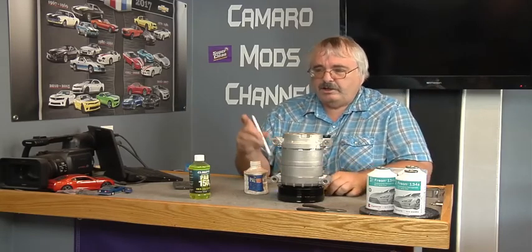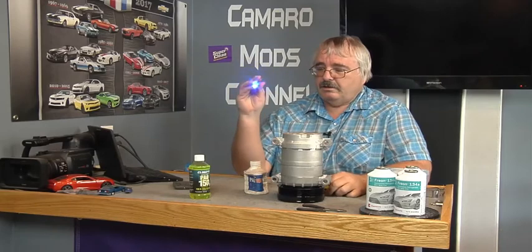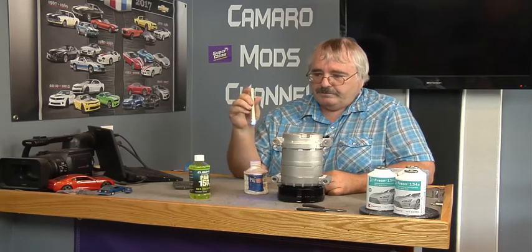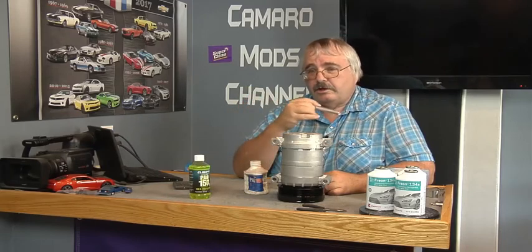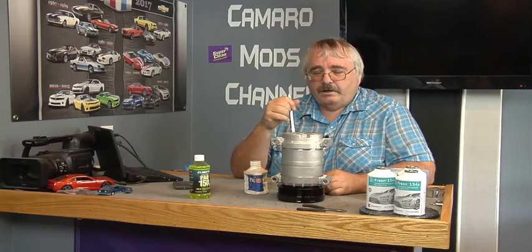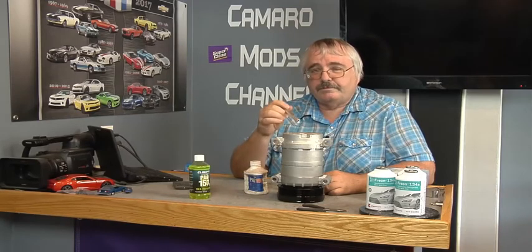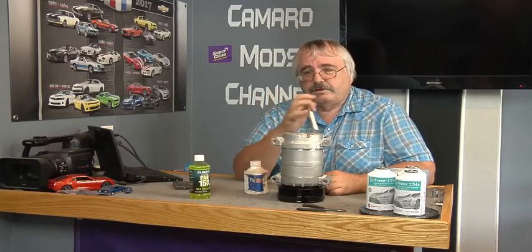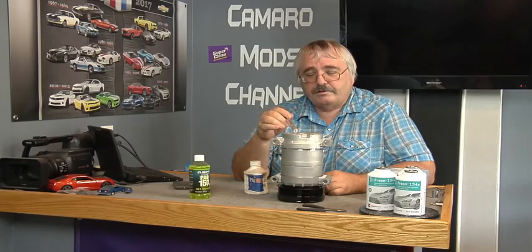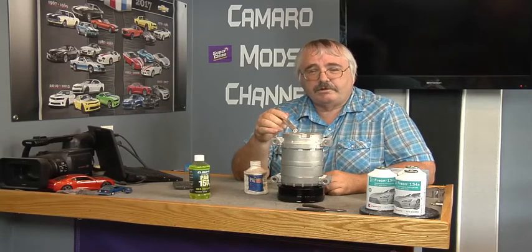But we'll go to the truck, and I've already recorded this clip, but I use this little black light right here, and I found my leak. But I'll show you all the stuff that I replaced on the truck. Basically everything except for the evaporator, which is the part that's inside the truck that gets cold, and the compressor. I didn't change the compressor. And guess where it was leaking at? The compressor.